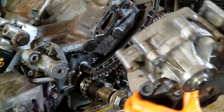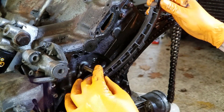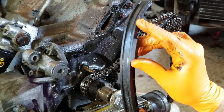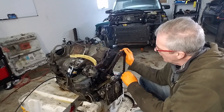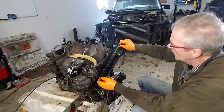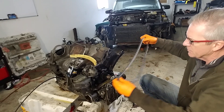With all the bolts removed, it took a few love taps from a rubber mallet to coax my timing chain cover to come loose. Fortunately, I planned ahead and bought a new timing chain guide — it's a good thing, because mine was showing some wear and even had developed some small cracks. Now that I've had a good look at the timing chain, I don't think this is original. I think it's very likely that when the head gasket was replaced by a shop in Ohio about 17 years ago, they also replaced the timing chain. But I didn't know that going in, so we have a new chain that we're going to put in place just to be on the safe side.